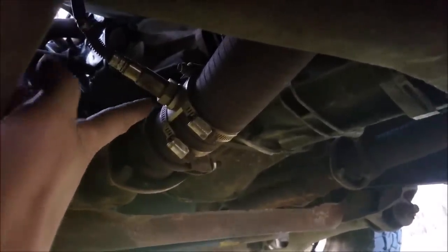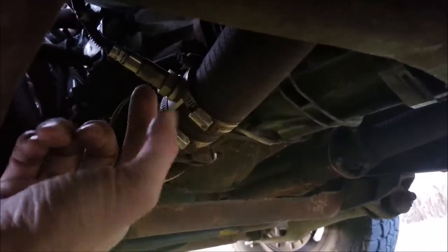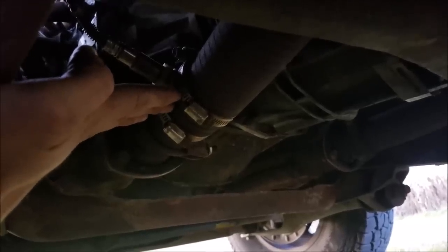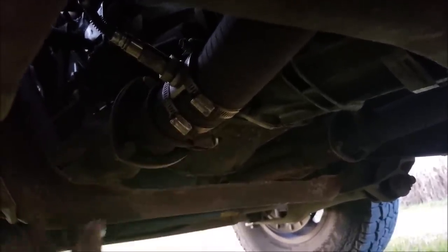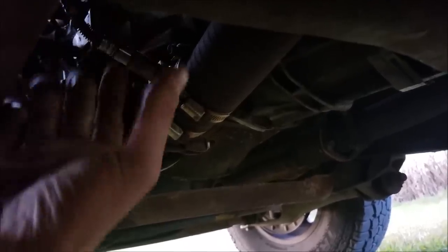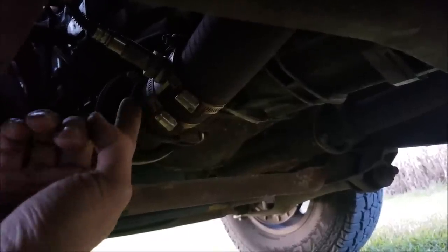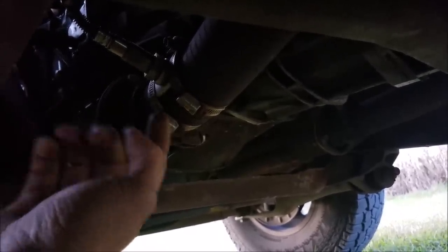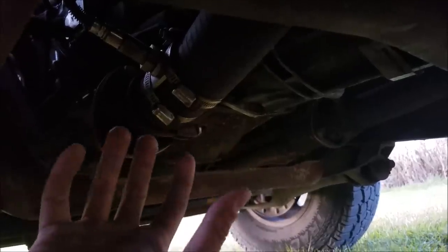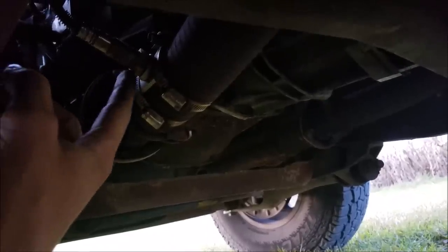The biggest thing with these sensors is you want to come in at a 45-degree angle. There's reasoning behind that — moisture building up on it needs to be able to drain out. You want to avoid drilling it in horizontal, and definitely don't want to be coming from below because then you have a ground clearance issue. The best way to drill the hole is to use a step bit and a 90-degree drill attachment if you don't want to take your exhaust apart, which I really didn't. We just chucked the 90-degree drill attachment on with the step bit and hogged through it, and it all worked out nice.